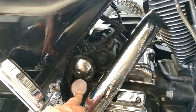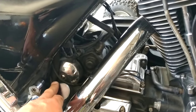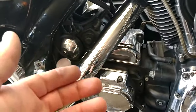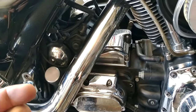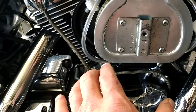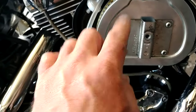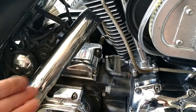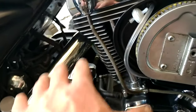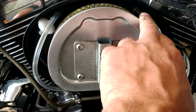The reason for that is the less oil you have in there, the more air you have above the oil. The oil will not compress, but the air will. So if you leave as many cubic inches of air in your crankcase on top of the oil, that will smooth out the pulsation. You've got a relentless pulsation from these pistons going up and down, and that forces the vapors or the crankcase fumes up top. The more cubic airspace you have above that oil, you're increasing the cubic airspace for that to compress — it becomes less violent and less aggressive. You'll get less of those fumes up to the top breather outlets to begin with.